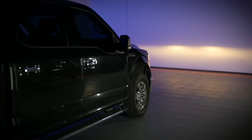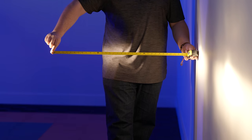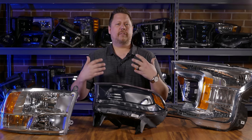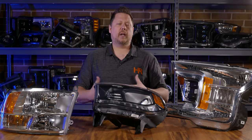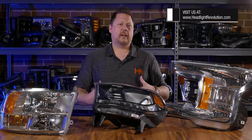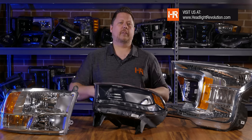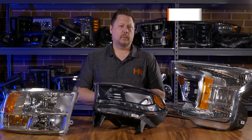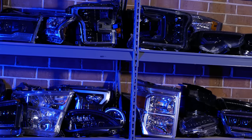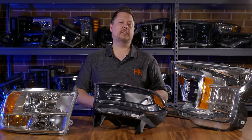There are two things you're going to find on your headlight itself. First, pull your vehicle up to the wall about three feet away so you've got some space between your front bumper and the wall. Make sure that if one person normally drives your vehicle, you have somebody sitting in the driver's seat while aiming. If you normally carry a lot of weight or equipment, simulate that as well. You'll want about half a tank of gas and make sure your tires are aired up correctly.